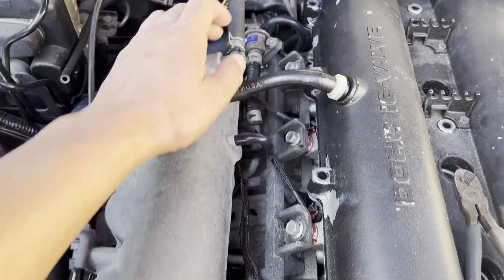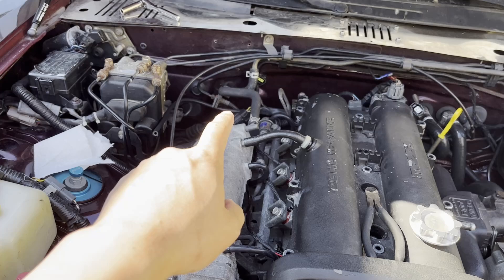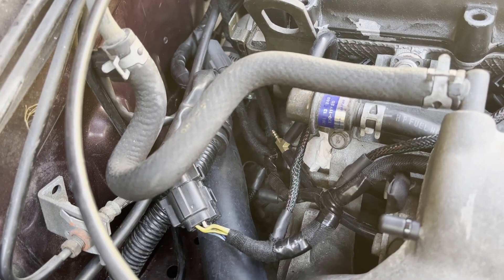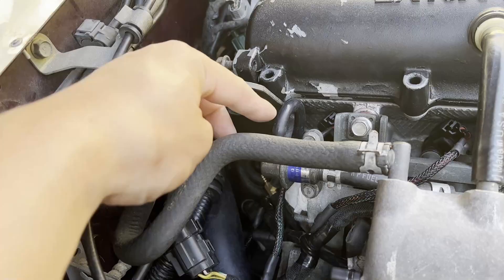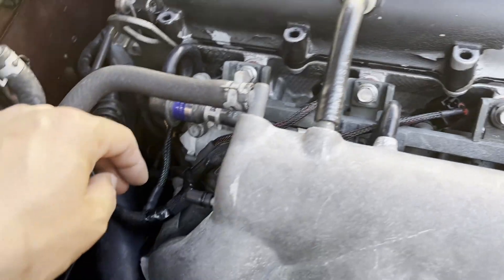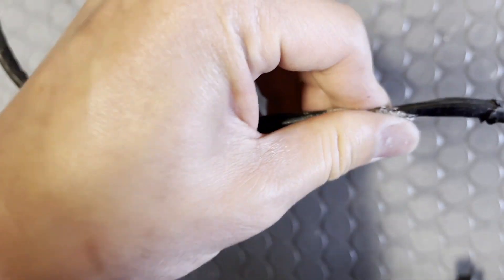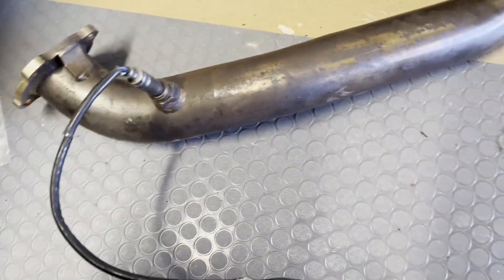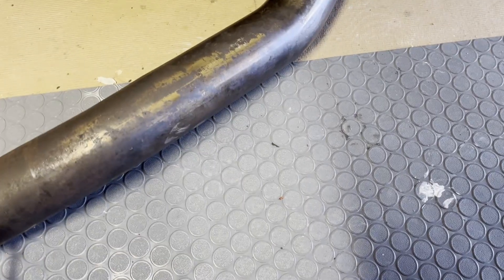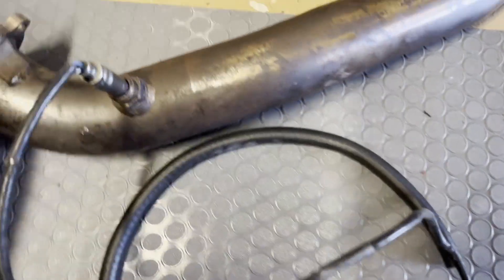So here are the new vacuum lines — definitely cleans up this area a bit. Next we've got to run a new vacuum line from the T through the firewall. We're tapping into this port for vacuum using a brass T, running it in between the manifold and the fuel pressure regulator — this is where we're going to get our boost signal. Originally the car had the boost gauge running from here but after reading Flying Miata's instructions it's probably better to pull the vacuum from here, so I went and capped that off. The wiring surrounding the OBD wire has gotten a little bit melted — I'm going to use some hose cut in half to protect it better from the heat. Let's get this on and then we can get the downpipe on.